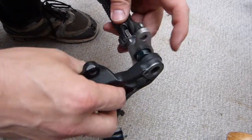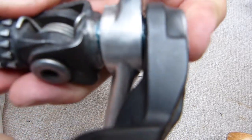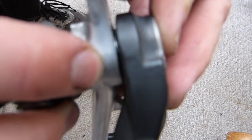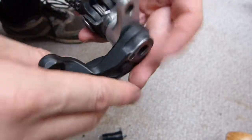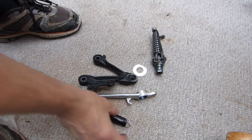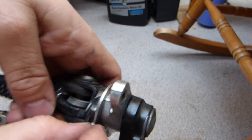you can see that, well, it doesn't matter much if I add the brake pedal back on. You can see that the gap there between these two, the bracket and the pedal, allows really only just one washer to be placed into the gap, and that's gonna be on the outside there, and over here aluminum will run on aluminum. I can't have two washers, so I'm gonna test the assembly this way, and we'll show you how this spring goes on. The test fit is going well. I discovered right away something: the pedal doesn't move because this washer is too thick.